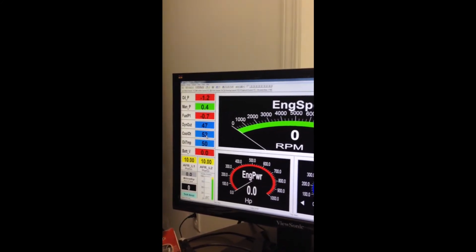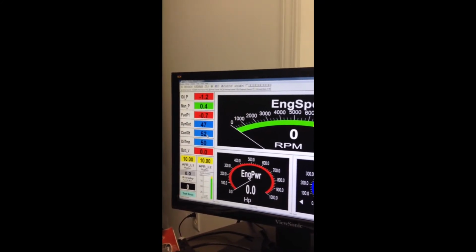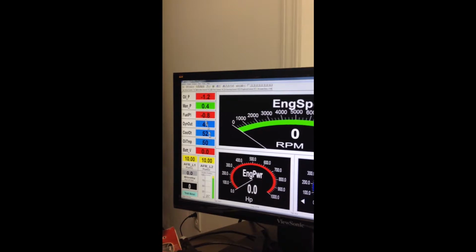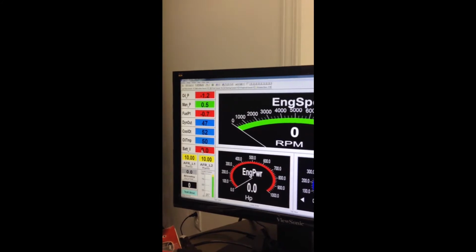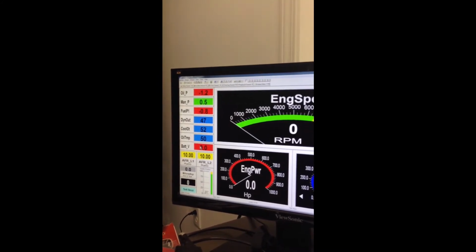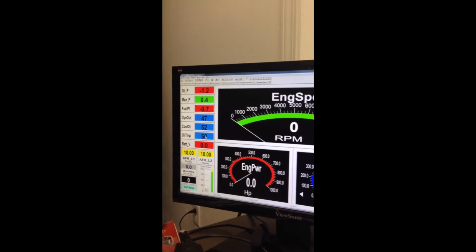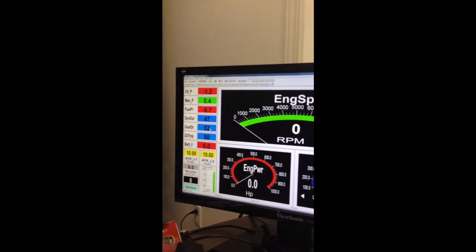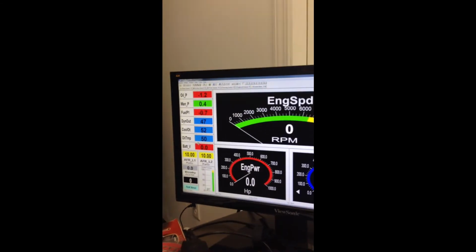This is the coolant out, which is the coolant temperature of the engine, your oil temperature, and your battery voltage. So for this section here, when you dyno an engine, you want to make sure that you have back-to-back runs that are comparable. So we want the oil temperature to be the same from run to run. Pretty close, within 3 or 4 degrees would be great. The water temperature is not as important, but you want that to be the same too. The other things are pretty much going to stay the same.